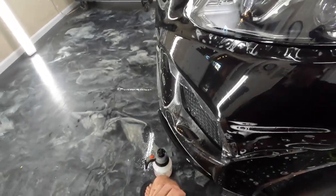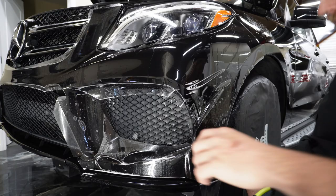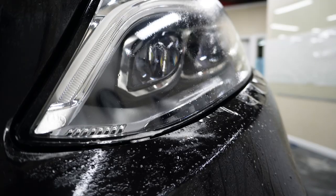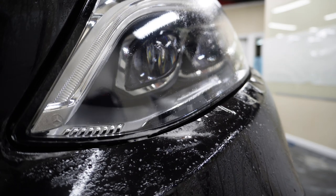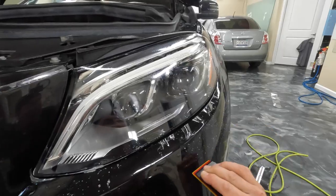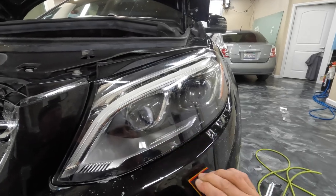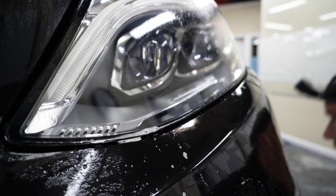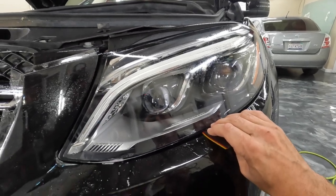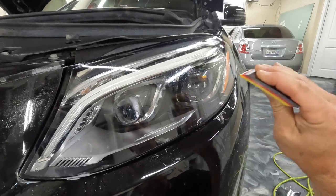All right, so this up here, we're gonna put a little bit of alcohol in it right from the get-go. With that little bit of extra soap, we know it's not gonna wanna stick. Let's see, can we get in here to see this a little better? There we go. So these little guys are popping back up. The technique I'm using to hold those down is going past them and then pushing down on them with this part of the squeegee on the very edge.